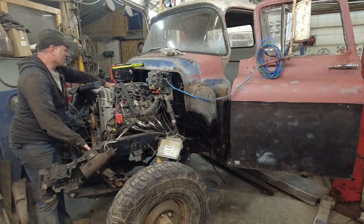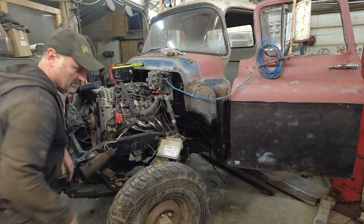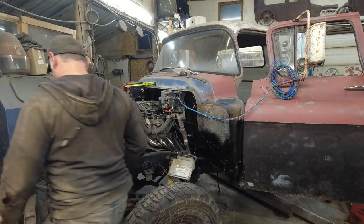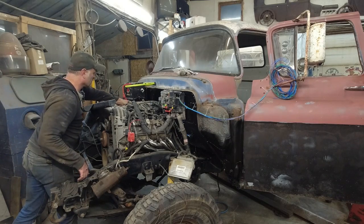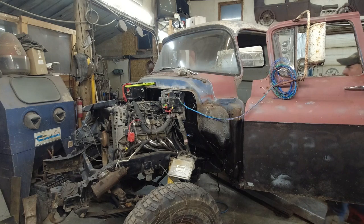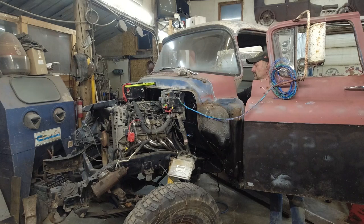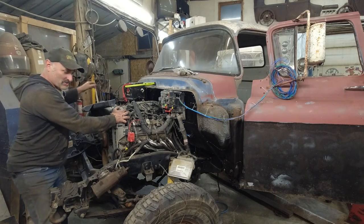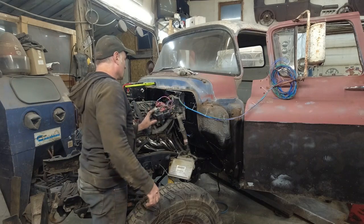Let's do the old pokeroo at the rail here. Just dust. All right, I think we got something. I just think that pump is super hard to prime. All right, and now we have nothing. I am going to troubleshoot for a while and we'll be right back. We've got fuel pump. I believe we have pressure, but when I crank, I have nothing. Oh yeah, we got fuel pressure, so that's fine. I'm going to go through this and check stuff over here.